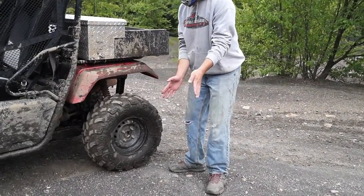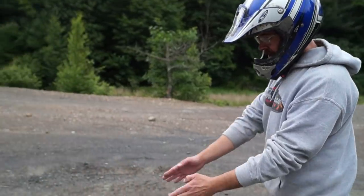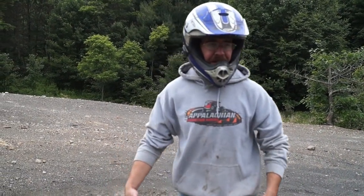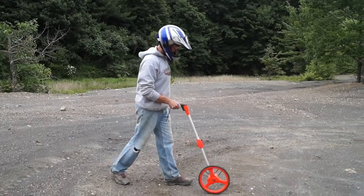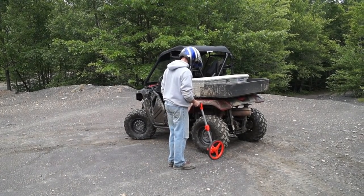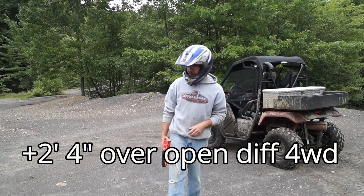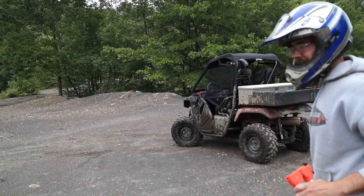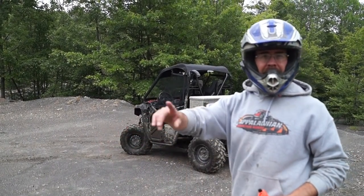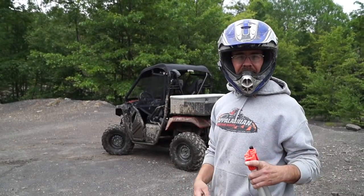You can see we've slid up from our line — I'm actually sitting on the two-wheel drive mark, and the four-wheel drive result is out here. So the whole machine kind of slid this way as we turned. We are at 16 foot 10 inches. So we added about two feet to our turning radius in four-wheel drive. Again, with a machine this little, that's still a pretty tight turning radius, but having the Torque Locker is going to make a difference in how sharply we can turn — which is something you'd expect when you have something that has the ability to truly lock both front wheels.